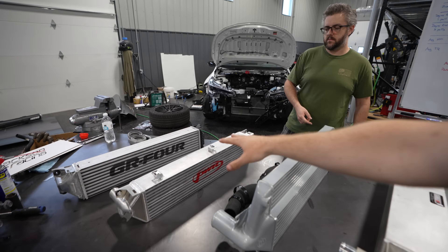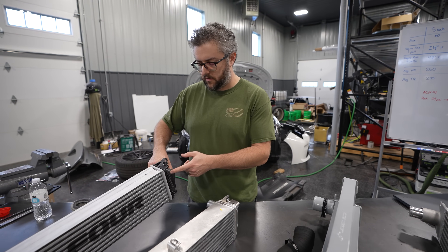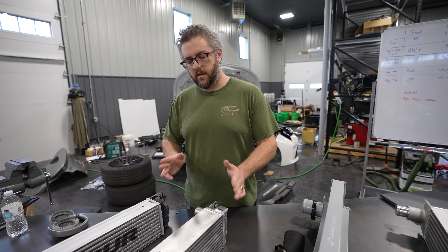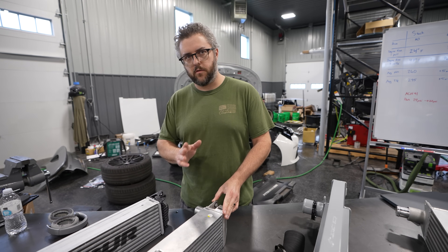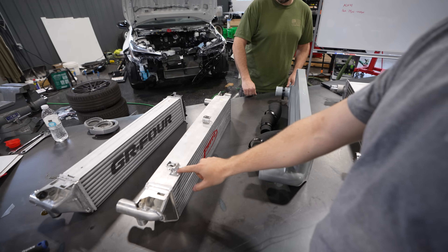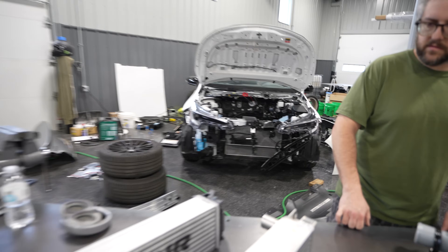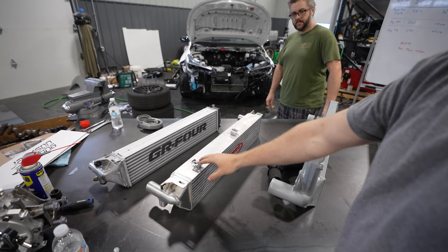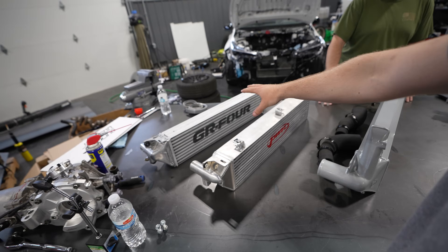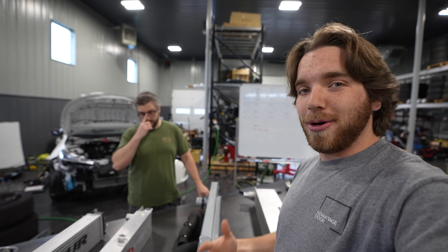Starting with the PWR — it's great if your car has been in a front-end collision or you're running so much boost that you push the plastic intake apart. Otherwise, on a modified car, I just don't want to run it. It is a nice, quality product, but it doesn't cool the air nearly enough for a modified car. We actually ran this one on the race car when it was making 450 horsepower — that's why it has those custom brackets and a little black oil cooler mounted on top. And honestly, like I said in the intro, I regret not going with a better intercooler earlier.